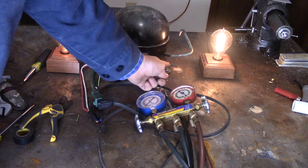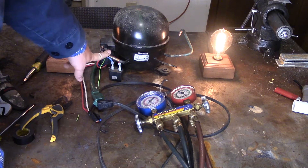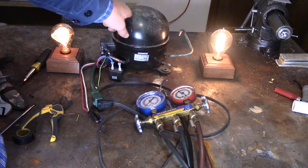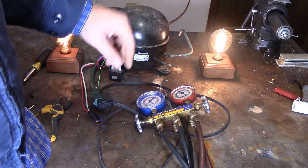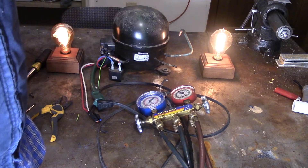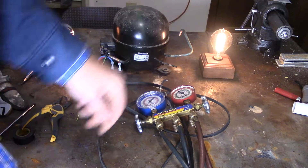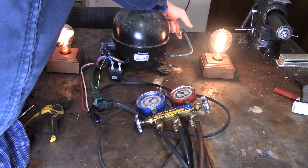So there we have it. What I'll do is chop this off — it'll give it a little bit more flow. I'll unsolder this connection right here; that'll give it more intake and even more flow. If you wanted to give it a bunch more intake, you can cut out a hole on the top area, maybe diagonally a little, but be careful because the oil will splash out. That's why you don't tip a refrigerator compressor upside down — it's bad for it. But you can see it does a pretty good job of moving air, and if I put my finger over the tip it'll turn into a vacuum pump.